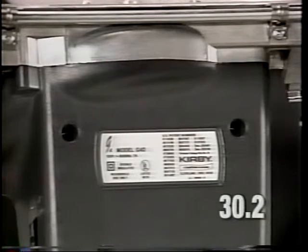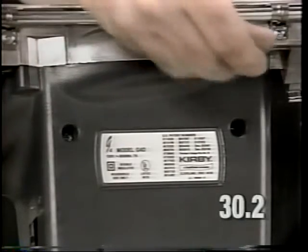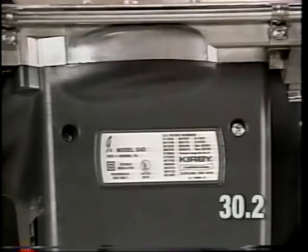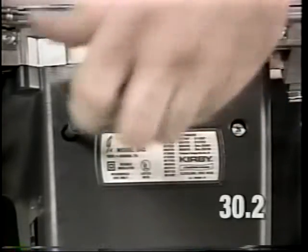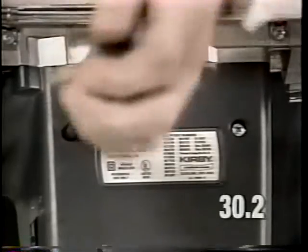Turn the base pan over and install the front motor mount screws in the wells located behind the fan case. Torque the screws to 22 to 26 inch-pounds. A loose screw could cause a motor vibration problem. If the screw will not tighten, replace the clip on the motor housing.